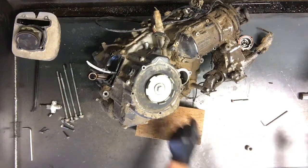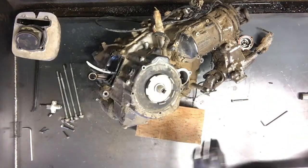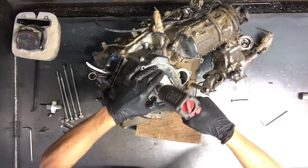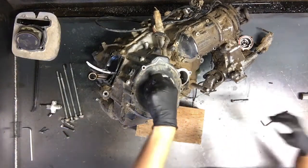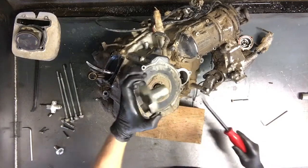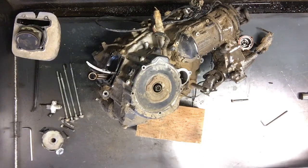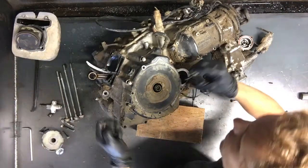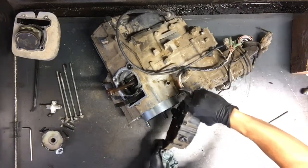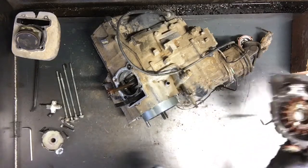There's a sensor down here we'll pull off at some point. Now we'll pull the stator off. It's a 17mm for this recoil cup. Make sure you don't spin that motor when you do that — if you do spin the motor, it'll potentially break the case down there with that cam chain just sitting down there. Pull the cover off here. A lot of times it's going to take a little bit of pressure to pull the recoil cup off. You've got 8mm bolts all the way around this stator — 9 of these bolts that you have to pull off. Then pull the stator cover off. Here's your stator, here's your flywheel. Stator looks good, we'll test that.